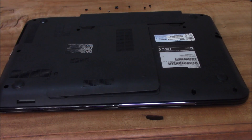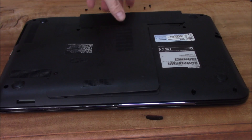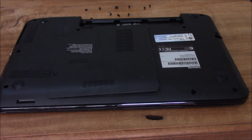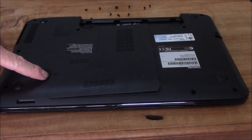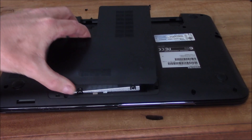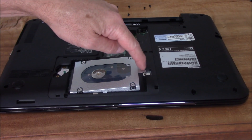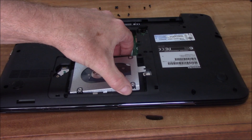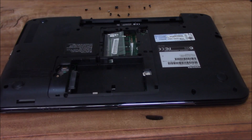I've already partially pulled this laptop down. What you start with is the battery pack, held in by two locking tabs. Once you release those, the battery pack will just pull out. Next step is pulling off the hard drive cover — in this case it's held in by one screw. Once that screw is released, it's held in by a few clips but you can gently pull that out of place. The hard drive itself is held in by one screw, and once that's out you can gently pull it out of the terminals.